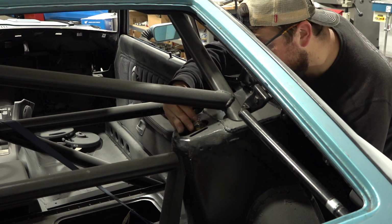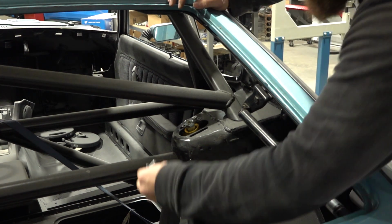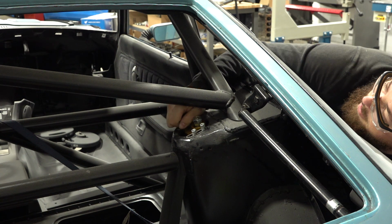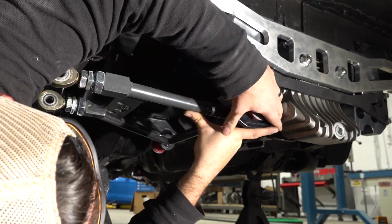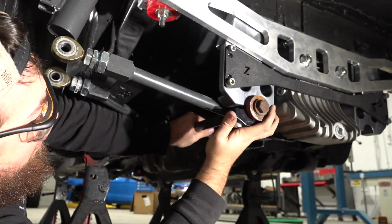This kit included the camber plates that I previously welded to the perches, the coilovers, differential mounts, and the uprights to accept off-the-shelf wheel bearings from an R200 or R230 equipped Nissan. All these parts are significantly stronger than what was originally offered in 1977 and will give me a ton of adjustability to the suspension.